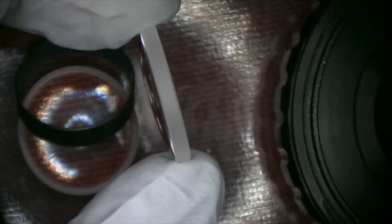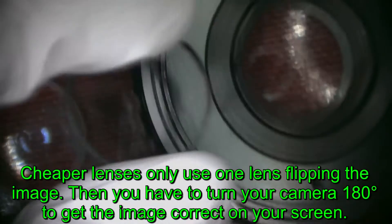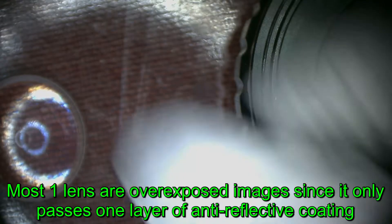This is very important for insertion: you can see on the left side how the lens is curved inward. When you put it in, you want that curvature facing you — or another way to put it, you want that curvature facing the spacer. In the end, both lenses will be curved in towards each other with a spacer in the middle. Make sure to get all the dust out, so I'm going to clean the spacer as well. Sometimes I use tweezers to drop it in a little easier.